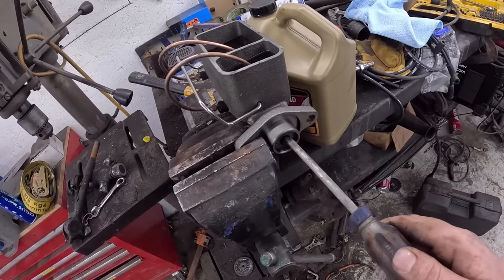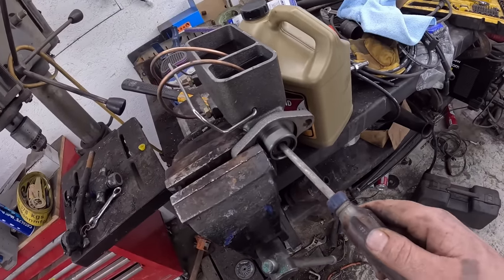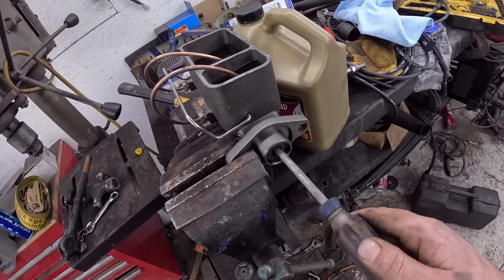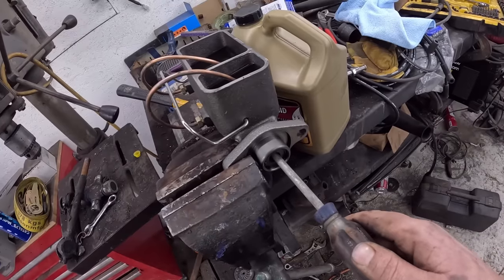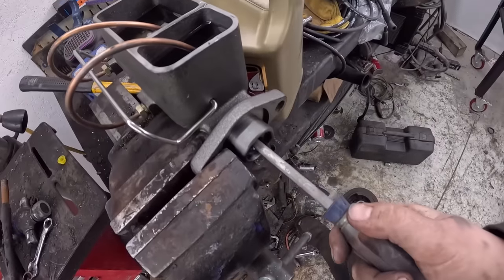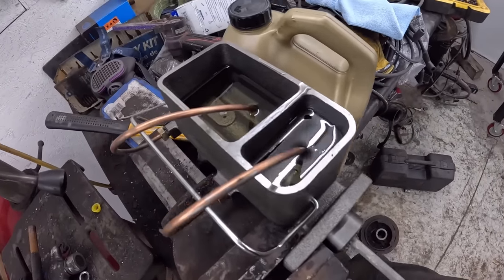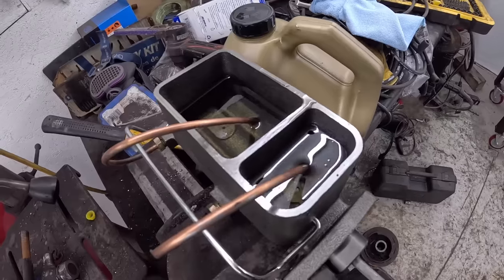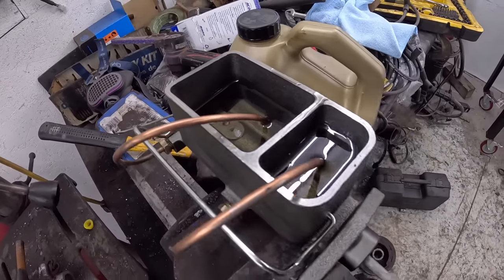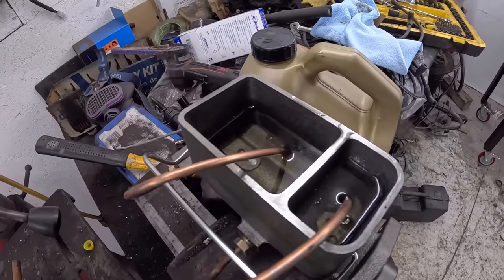Now, that's the rod we're gonna take apart and clean and lubricate and make sure it's adjustable, because you wanna make sure when your foot is off the brake, there's some play in the rod. You don't want it jammed in there, because if it is, it'll hold pressure in the brake system. So now we're gonna push this in, and that's just gonna force out any air that's in the system. Some of these come pre-bled. This one isn't really pushing a whole bunch of air, so I guess we should be fine.